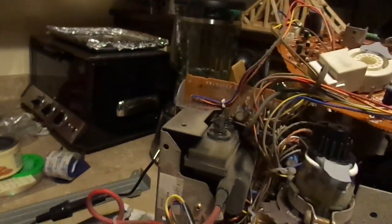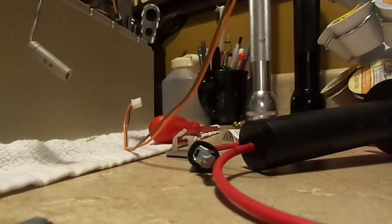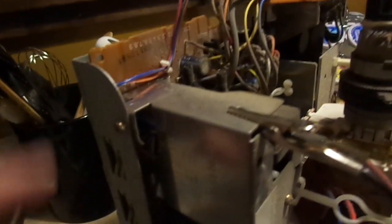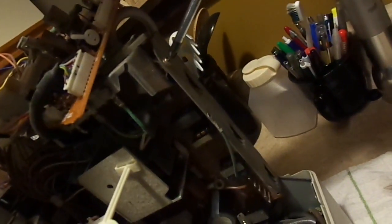This cable goes to the CRT neck. This is the deflection coil, and this is the CRT gun itself — this is what really generates the image. The deflection coil connects directly to the board using those cables, and those have to be undone. To get the board out I've got to disconnect this shield from the chassis rail. There's one on the other side, and a ground cable that has to be done as well.